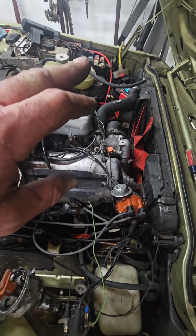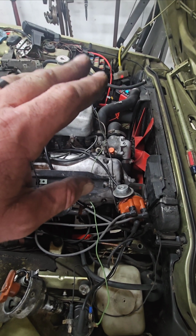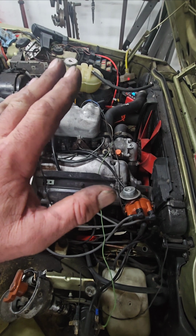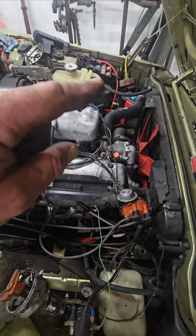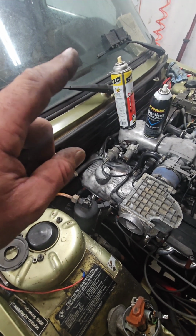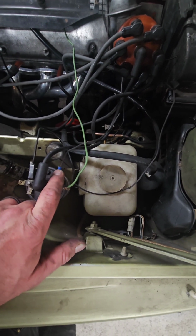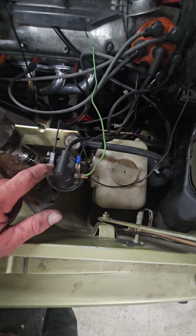It'll go into the engine diagnostic port, which is nothing, right? Because you don't plug anything into that anymore. So it dead ends there. And then another black one, you can kind of see my reactor wiring. Another one goes into the reactor wiring. I'm cutting all that stuff out, so you don't have to worry about that. So basically, the black wire that goes from the distributor to the fuse box will travel into your tachometer, okay? And that's important, so remember that. So 8 volts from the fuse box, 12 volts from the starter, and then this is going to go to the distributor and also the tachometer.